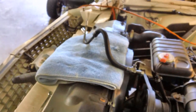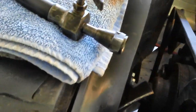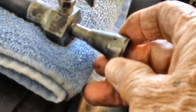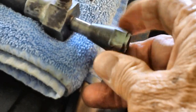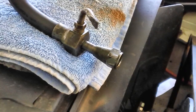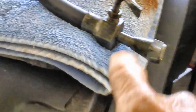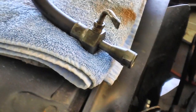What we're going to do is come out with a line. First I'm going to have to cut off this long flare nut — this one here was kind of rounded off. I looked all over for this and no one in town has one. When I talked it over with Brendan, he said that's a long flare nut and there's also a short one. He said go ahead and reuse it if it's reusable, so I'm going to have to cut this off. None of the hardware stores or parts stores had it.